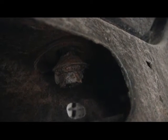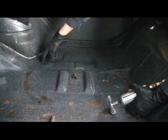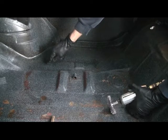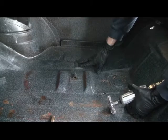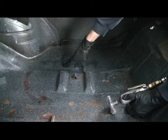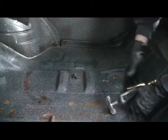This next one is in horrible shape. You can see the rubber here, and on the inside the rubber isn't even there — it's totally gone. But again, hopefully not going to be too much structural metal work on this side. What I'm going to do on the inside is cut away the non-structural sheet metal. One frame mount is right here and the other one is back over here. I'll clean off the paint and spatter paint, cut out a chunk, get at that cage nut, hopefully save it, and then weld the piece back in — that would be the plan.